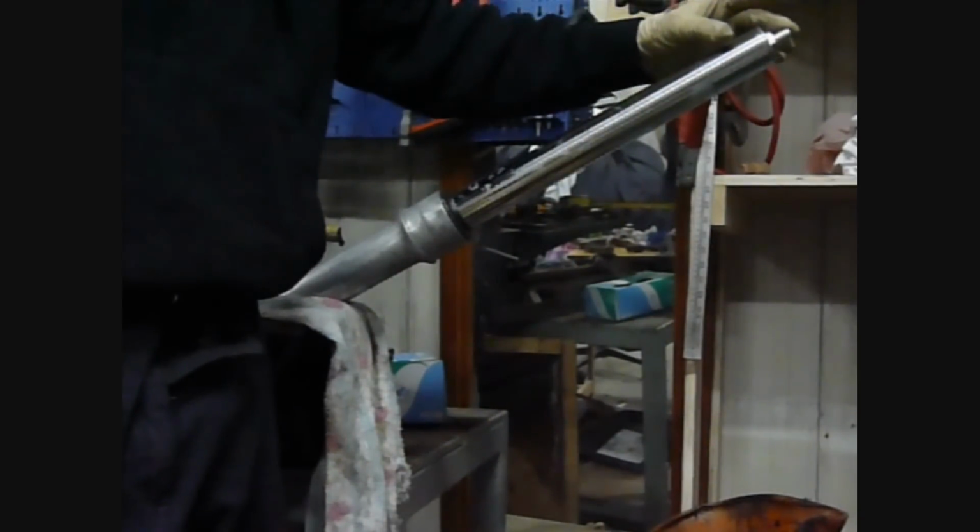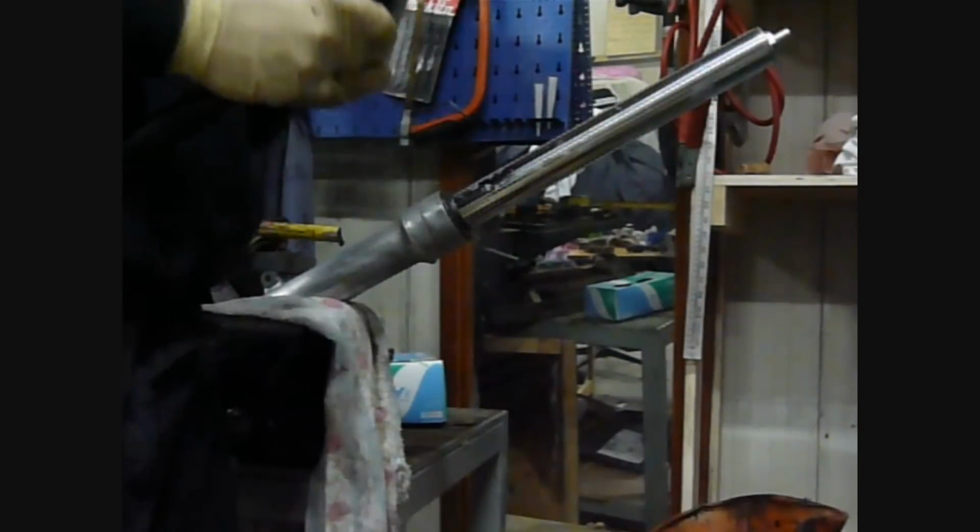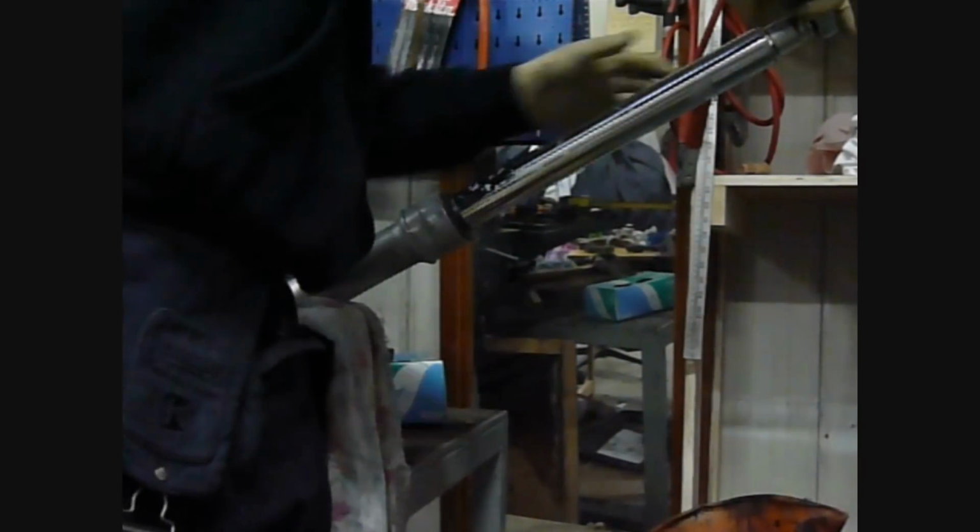Other considerations are these bolts here need to be removed from the mudguard stays, and then you will see that the fork is actually loose. So as you can see, it's dropping up and down through the yoke there. So it is. Here we loosened off the preload there. Size 24, it goes on the top.